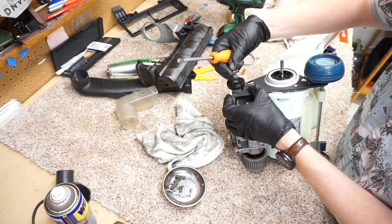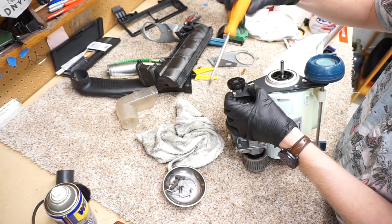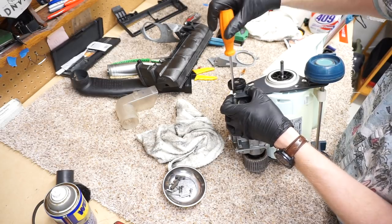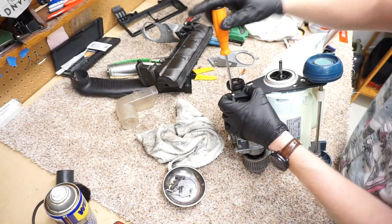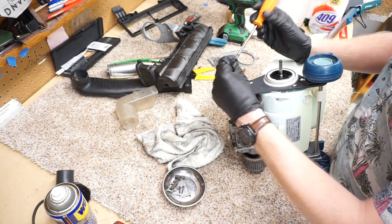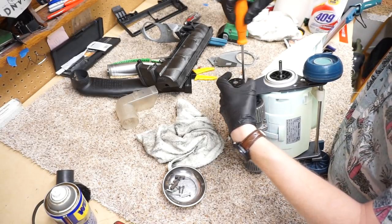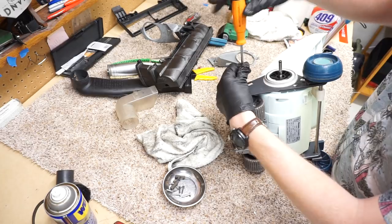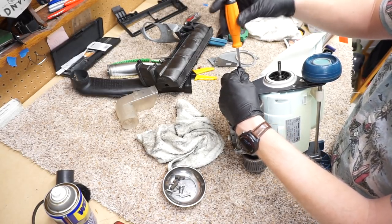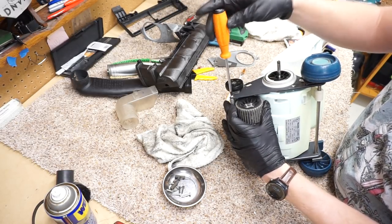And it looks like there was originally some Loctite on here, as well as this lock washer, but I think the lock washer with the proper amount of torque. And when you put this on, it's kind of like a lug nut. You want to make sure, you kind of want to do that with anything. You want to put the opposite screw and make sure everything's lined up before you start tightening things down. Unless it's a Nord lock, lock washers don't do much. At least so say the experts.